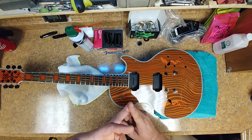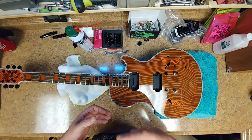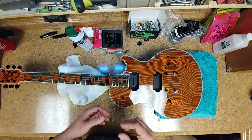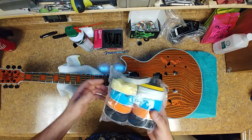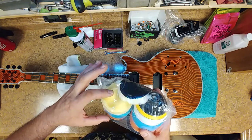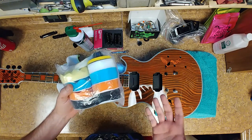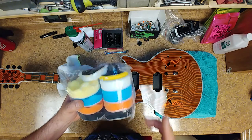If you have too many RPMs it's going to cut quick, so you need to get the feel of it and know when to stop. Be careful around edges so you don't burn through. Adding a little water to the pads and squeezing them out so they're just mildly damp helps with friction and heat. I liked this kit so much I ended up ordering another one — this kit has pads with an egg-crate type texture, and also flat pads. They also work on a small handheld air buffer we have in the garage, which is great because those pads are on their last legs.